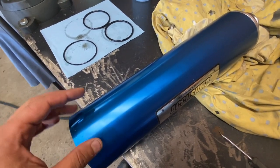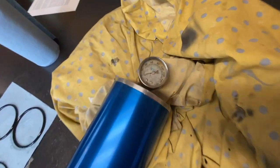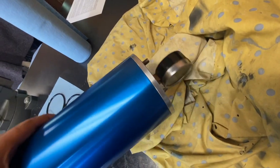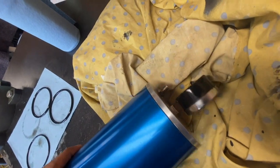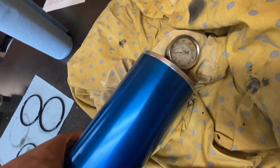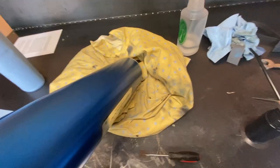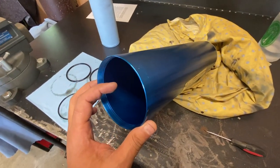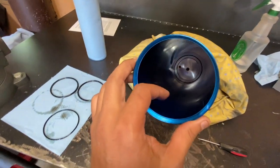What I did is I took it out, pressurized it to 60 PSI, and I actually dropped the whole front end in water just to make sure that the gauge and the Schrader valve weren't leaking air — and they weren't leaking anything. But as I did that, I was outside and I put my ear over the oil side and I could hear some hissing, so I knew that air was leaking from that side.